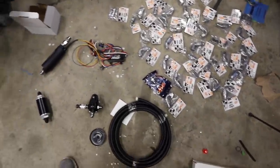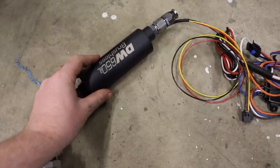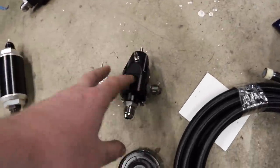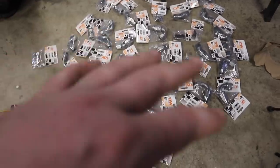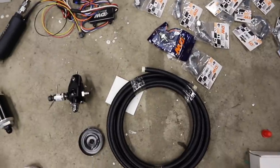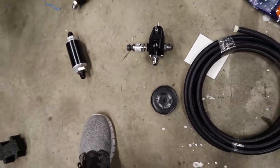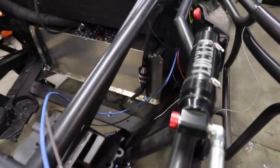This is the new Techwerkz 650 brushless inline fuel pump — a brand new product, not even sure it's on the market yet, they sent it to us for testing. Also included: a pump controller, fuel pressure regulator, fuel filter, all fittings we could need, and a bunch of 8AN hose. Everything on this engine is 8AN. I've already outfitted the fuel pressure regulator with a digital fuel pressure gauge so it can report to the ECU. Let's go install all of this.